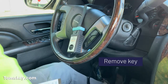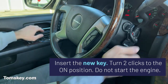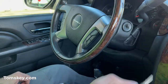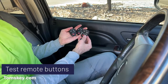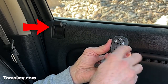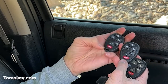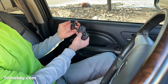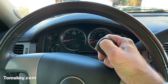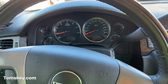I'll remove the key and unplug the easy installer. Before you test these, it's a good idea to start the engine, turn it on, open the car door, shut the door, then turn off the engine. Now let's check our remotes — here are our new fobs, let's give them a try. Fob number one works. Fob number two works. And our original one still works as well. Just for fun, we can check the alarm. Let's check the remote start. There we go — just like that. New fob's been programmed. That was not very hard.